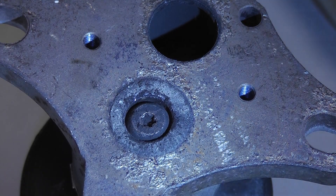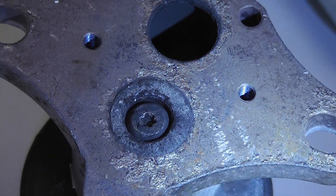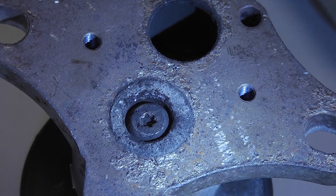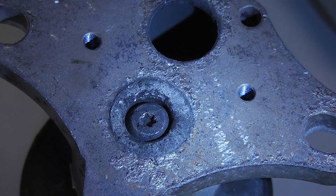That's what causes it to stick — those carbon deposits. You can clean them probably eight times out of ten: pull it apart, clean it, put it back together, you're good to go — no reason to spend the money. Again, this is not associated with our P0401 flow trouble code, but I figured while we have the valve off, I'll show you that one too.